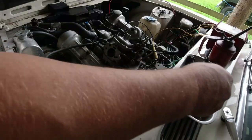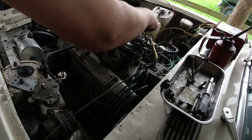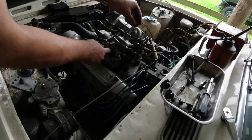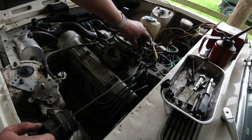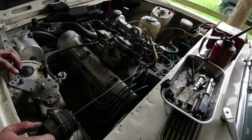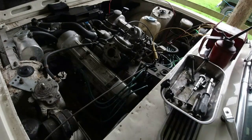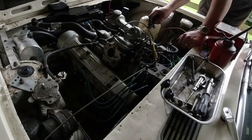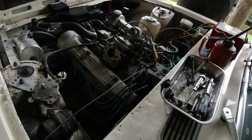You don't want to run it too lean. That seems quite sweet. That's a lot better. I'm not going to touch it anymore. If I do adjust these two now, I do need to check the airflow balance again. We've got seven on that side - should have changed. Ten on that side. One back. Down to eight and eight.